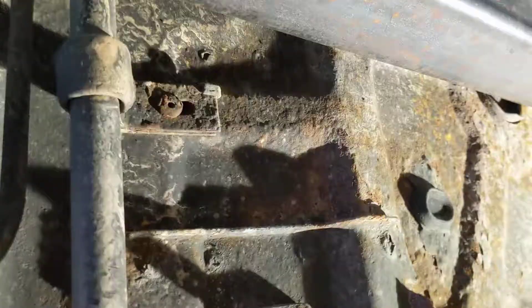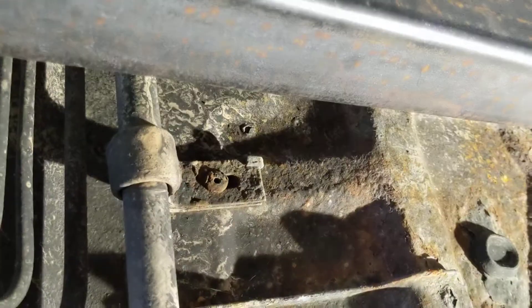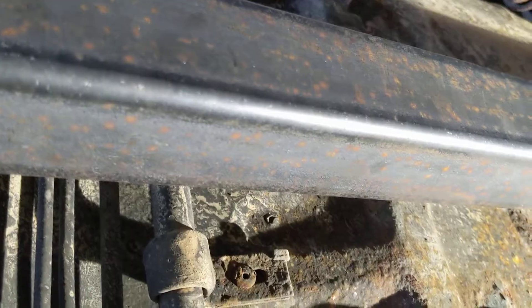For the moment, I need this beam sealed in place. This is a subframe connector — you can kind of see it. There's a second one about to be welded in over there. And once I'm done with that and my pivot casters, I'll be able to lift the car up from — I'm going to guess the point is right about here, I'm not sure exactly. But we'll set screw that thing in place on both sides in the same spot, put a jack stand under it, and we should be able to tilt this thing up and lift it up off the front end.